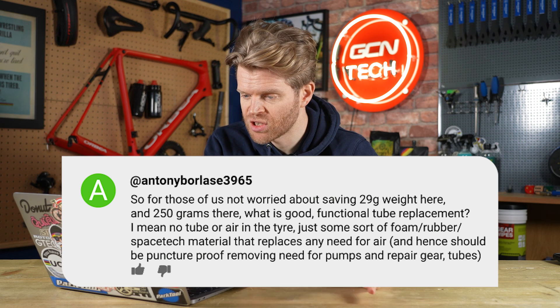I would suggest going for a more bombproof tire instead. In the case of Pirelli's, something like the Cinturato rather than the P Zero — it's heavier and slower in rolling resistance, but still fast compared to a solid tire, with way more longevity and puncture protection. You could also combine that with run flat foam liners. Mountain bikers use these a lot. If you do get a puncture even in a tubeless system, the tire is still rideable — not great, but you can get to your destination. Setting up tubeless with bombproof tires and run flat liners takes away some performance but massively increases practicality.